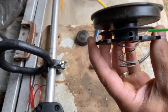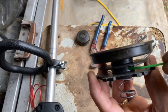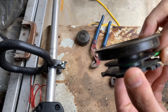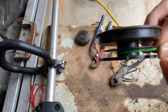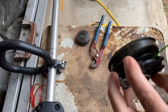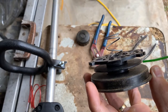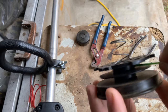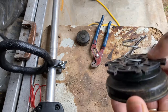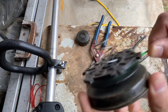The holes are angled to lock the cord in when you first insert it. If you put it in the easy direction — going with the angle — it will unspool when the machine spins and jam up your weed whacker. So you want to go against it, at a sharp angle back in the direction you'll be winding. It goes in about three-quarters of an inch to an inch and locks in really well. Once coiled, you can pull on it hard and it won't move.